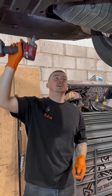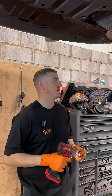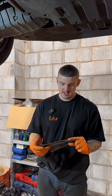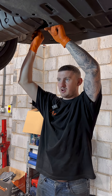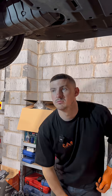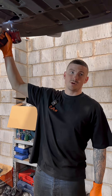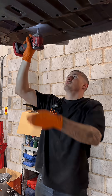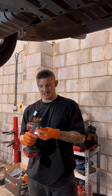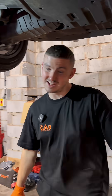Alex has just said to me that he didn't know that the tires had to be equal — and not just on electric cars. So if you have a four-by-four or anything like that, if you've got old tires, say around three to three and a half mil, and you get a puncture in one of them, in an ideal world you should replace all four. We understand we don't live in an ideal world, but you at least need to change them on that complete axle, because the last thing you want is to damage your rear diff. You put an old tire and a new tire together and the rotation difference will kill the diff.